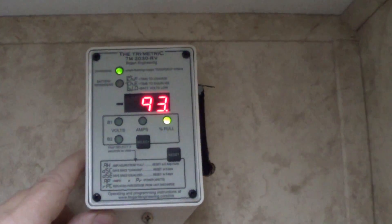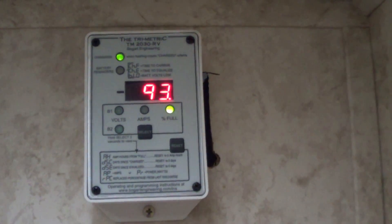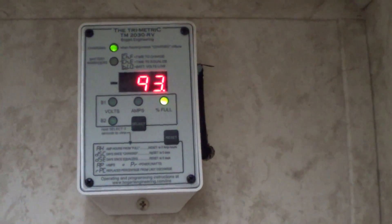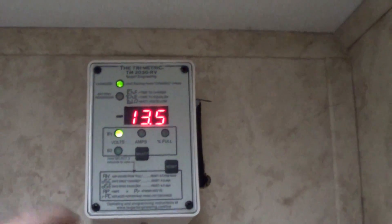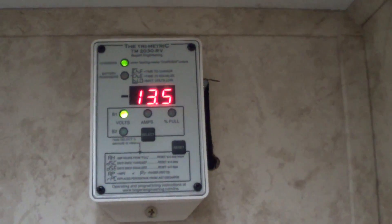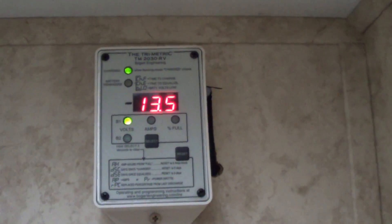This thing calculates, by the voltage and current over time, what percentage is left in the battery bank. I'm at 93% right now, which is really handy because you don't want to let your batteries run below 50% before you recharge them — otherwise you'll reduce your battery life and could damage them. It's good to have one of these more sophisticated monitors. Another brand that's really good is called Victron. But anything's better than those dummy lights they give you in RVs that just say fair, good, or charging — they're pretty inaccurate. A good battery monitor really helps with keeping your batteries happy.